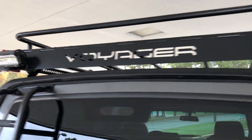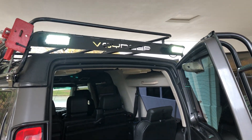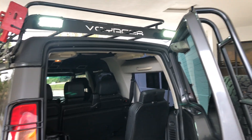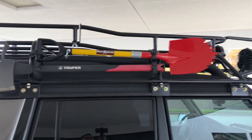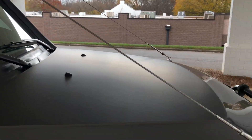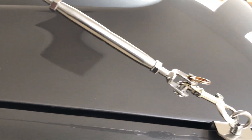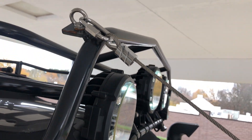Back here you'll notice these rear lights — we've got what we call camping lights back here. The way we've got those set up is, all you have to do is reach inside the cabin, flip them on, and now you have lights out back whether the key's on or the truck's running or not. They're always powered up, as are the front lights — all the auxiliary lights are powered directly from the battery. Over here, we're running the Trooper axe and the Crazy Beaver shovel, hooked up to the roof rack. And we're running the brush wires from England — directly imported, all stainless steel. We've got a quick-detach fitting so you can get them off in less than 30 seconds to access the hood. You can just take them off, quickly detach up here, and put them in the trunk if you don't want to drive around with them on.